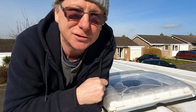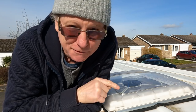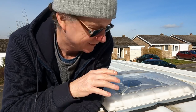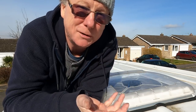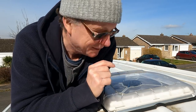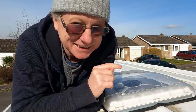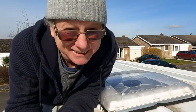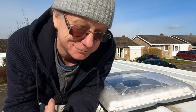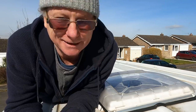Today is a beautiful sunny day so I'm on the roof of Rebecca's van. I'm going to remove her skylight because it hasn't been fitted properly — whoever fitted this didn't cut the hole big enough. The hole is only 380mm square and it needs a 402mm square hole. Not only that, it leaks as well, so it's got to come off so I can reseal it and cut the hole bigger and fit it properly like it should have been done in the first place.